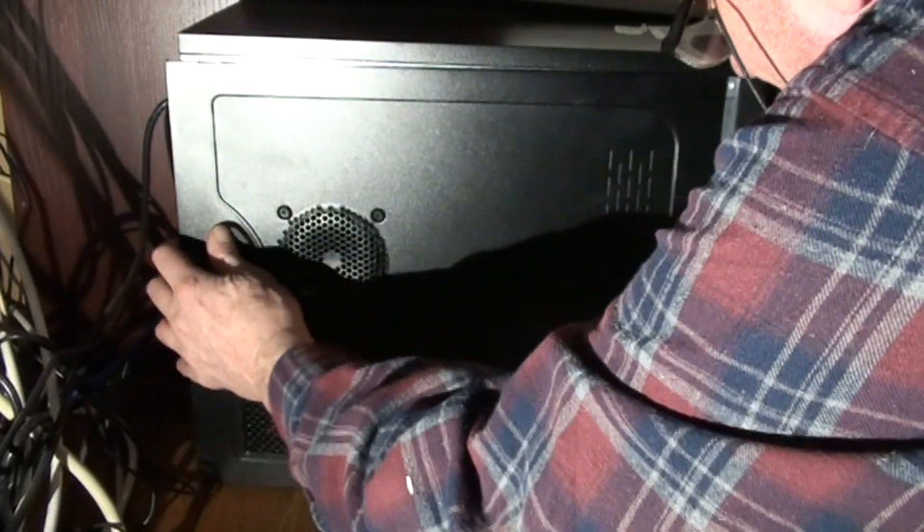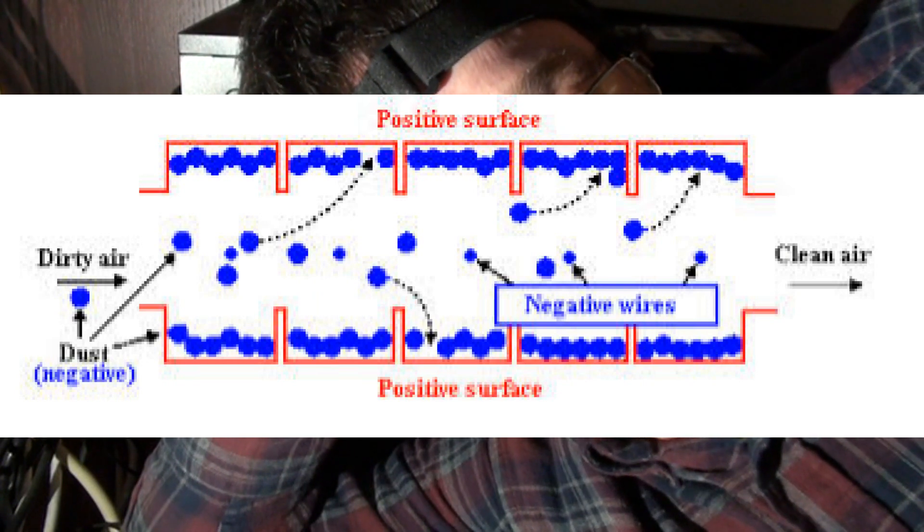Now our side cover goes back on, and that's basically it — we're going to put everything back together. This maintenance should be performed as needed, but at least once a year. These things get really dusty — it's just a simple fact of electrostatic charge and the volume of air that goes through them. This is going to give you faster performance and more reliability, as long as you don't physically touch anything with metal tools or the metal vacuum tip. Just make sure the power is off and the unit is unplugged. Once we're done, we can power this up and it's going to run a lot better — quieter because the fan won't be running so hard, it'll cool better, and you'll see an increase in performance. Thanks for watching — don't forget to share, like the video, and subscribe to the handyman zone. We'll see you later.